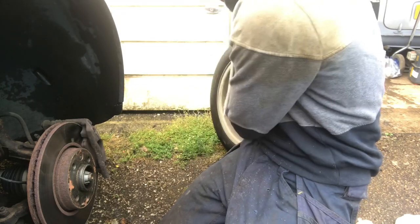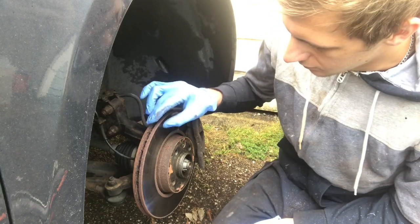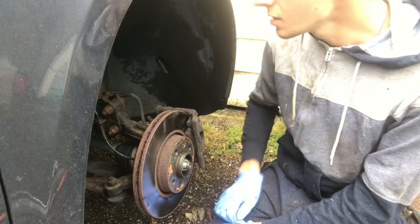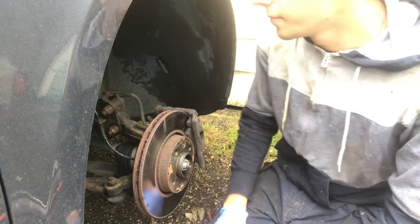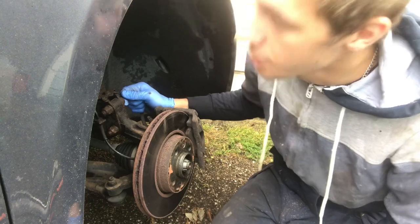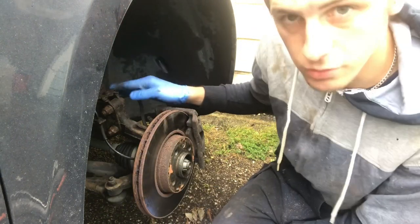First inspections — I'll have a look at any obvious signs of leakage, any signs of corrosion. So the brake disc has a little bit of a lip on it but no major scoring. The brake pads have a little bit of life left in them so I think we'll leave them. The actual spring up here looks in good condition — no corrosion, no broken springs. We've got an ABS line and a brake hose here. Just making sure there's no leaks, no damage, nothing loose with the braking system. No leaks coming from the actual caliper.